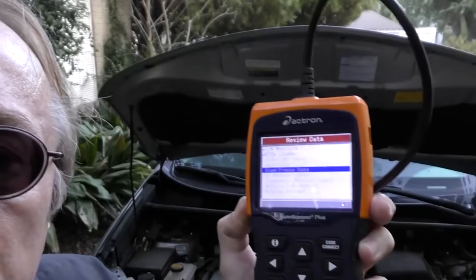If you're smart and have a scan tool — even a $40 one — go to the section called freeze frame data. You can look at when the code occurred. It'll show you the speed of the car. If the speed was zero, and the code tripped while it was idling, that generally means a vacuum leak — because at idle the engine has lower vacuum pressure, and a vacuum leak at that point will drop it enough to trip the code, which requires about 20% or more off value.